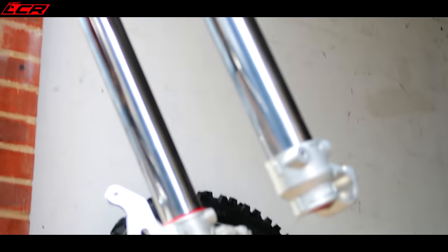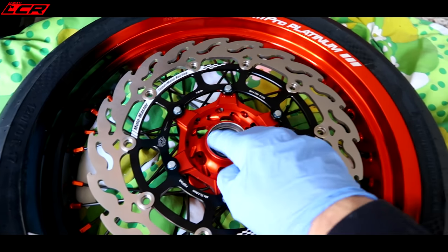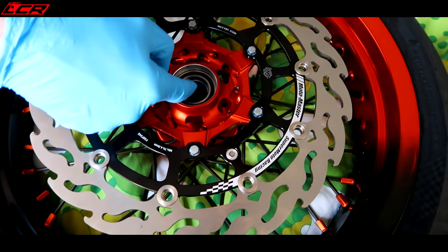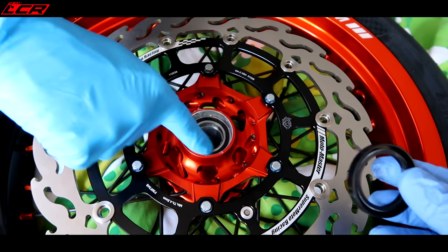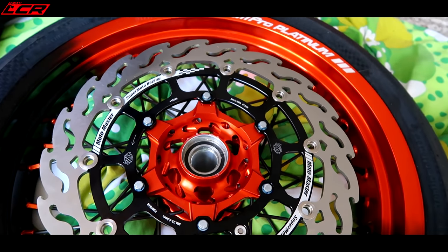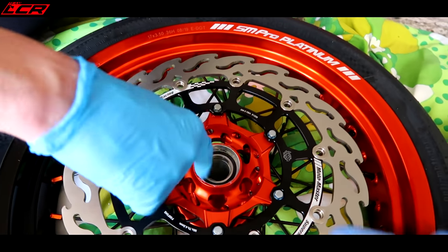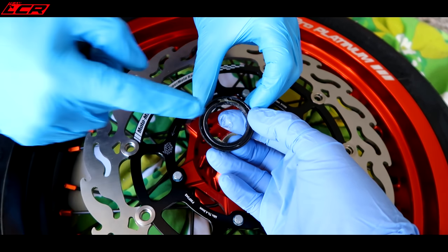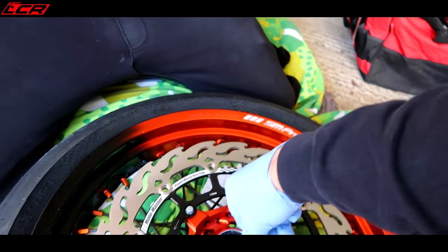Done! Bingo. Now you've got to look at your nuts — you've got the spacers and stuff. Get your nuts out. So we push the load in there first and then push it into the bearing. It comes with new dust seals and everything. In on top of the bearing — good wadges of grease in there, loads of it. Pack it right in — literally pack it like a load in. You want to get it in there and then force it in, really pack it in so it's absolutely crammed in. Get a load and be heavy-handed — right down on top of the bearing. Then flip it over onto the other side.